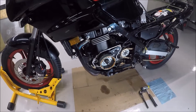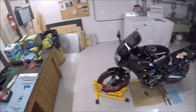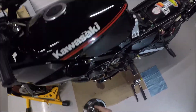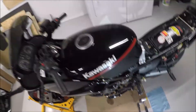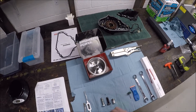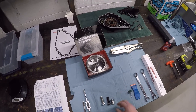I needed to get some special tools to do this, and I'm kind of regretting it because this bike has lasted almost 31 years — why change it now? I did need to buy a strap wrench. This is the RM stator flywheel — ultimately what I want to put on instead. You can see how different it is and how the magnets are encapsulated inside. I bought the kit that came with a gasket and a flywheel puller, but I'm not thrilled with the puller because the bolt it came with is not long enough to remove the flywheel from a 1990 EX500.